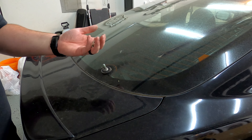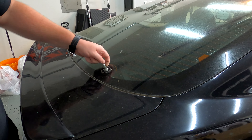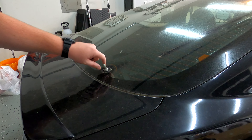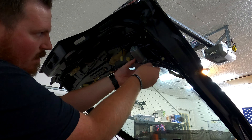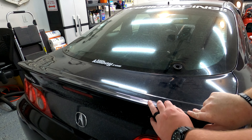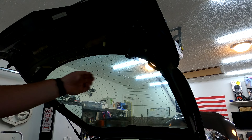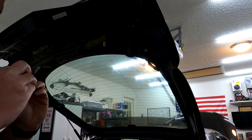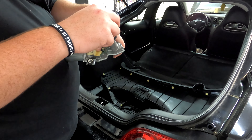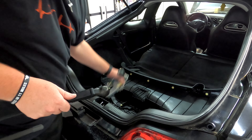Now that all the bolts are out, we should just be able to wiggle this thing down through the rubber grommet. We have retrieved the grommet. I'm going to reinstall everything onto the motor so I cannot lose it — if I ever need to give this to somebody or reinstall it myself, all the parts will be right where I left them. So there's our full assembly. What you get in the kit is two O-rings that get wedged between these two black pieces of aluminum. The top portion is threaded, and they give you a nut along with a stud. You take your top piece and thread the stud in, get it about hand tight, then snug it up with a number three Allen head.